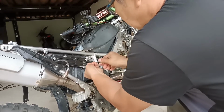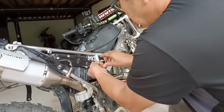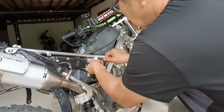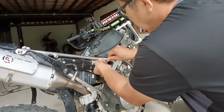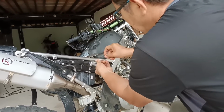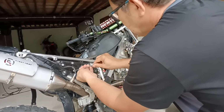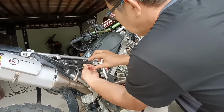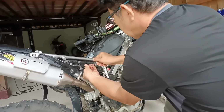Now, as always, when you're tightening a metal screw into plastic, you want to be nice and gentle. These screws don't need to be over torqued. Don't over tighten them because all you're going to do is pull the whole screw out of the plastic. And then you'll have to epoxy it back in. Not the end of the world, but clearly something to avoid.